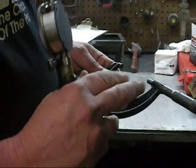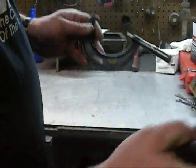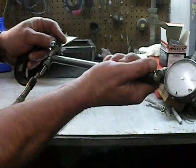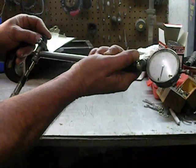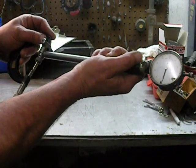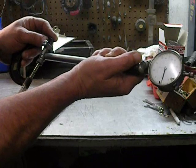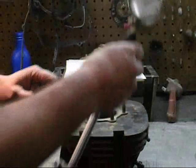What I've done is I took my mic and set it to my dimension 2.595. I'm going to take my dial bore gauge and put it between the faces of the mic. If you look at the bore gauge dial, I put a little black dot on there — that dot denotes zero. That's where I want this to be for a stock bore, which tells me I have a 66 millimeter bore. The gauge is already set to where it has to be, so I'm going to drop it in.